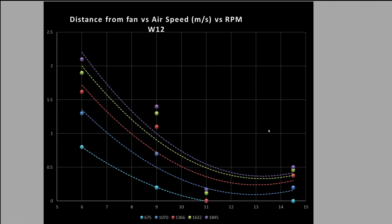First up is my case simulation test. Most importantly, this test reflects what size computer case you actually plan on installing this fan in. For small cases or short throw distances — like blowing from the bottom of your case up towards your GPU — the six-inch mark is what you want. This assumes a front-to-back airflow style case equivalent to holding a 120 millimeter class fan in that length. The nine-inch mark represents compact towers that can hold 220 millimeter class fans on the bottom.